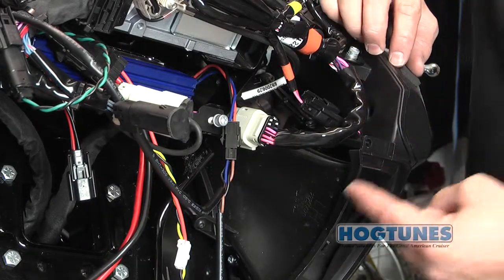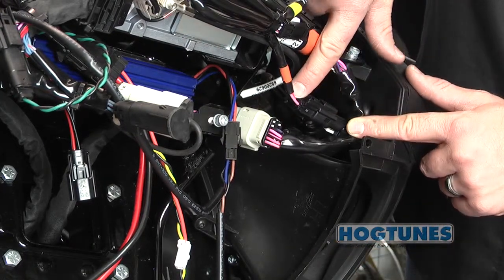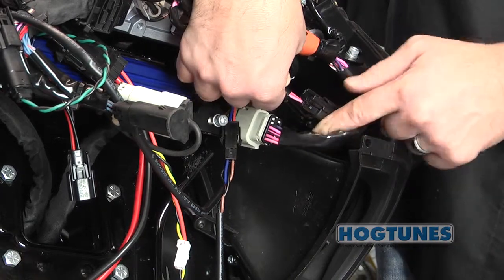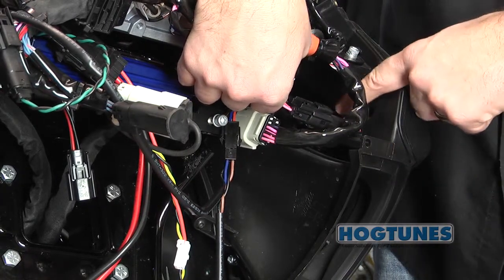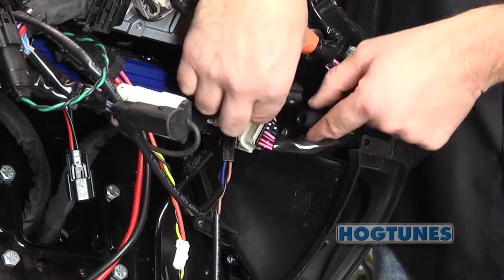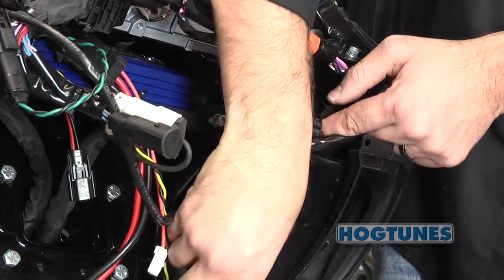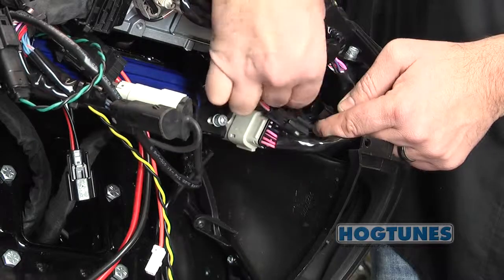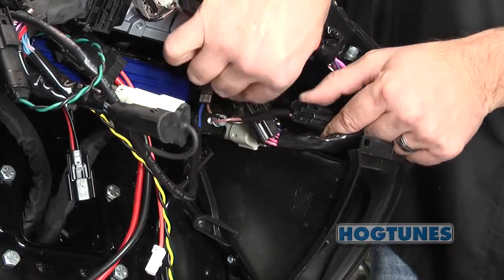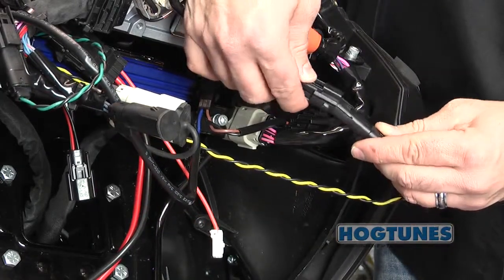On the clutch side of the bike, also just above the air inlet, you will see the same two-pin connector with pink and grey and pink with orange wires going through it. The plug is close to where the wires enter the clutch side speaker cabinet. Separate the connector so you now have two plugs. From the amp, take the plug with brown and black wires and plug it into the mating plug you just separated, noting it will only go in one way. Also from the amp, take the plug with yellow and black wires and plug it into the mating plug you just separated, noting it will only go in one way.